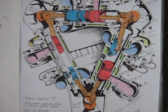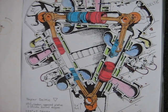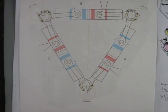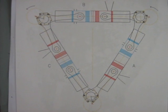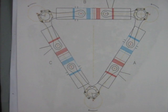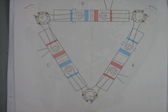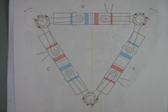The bottom crankshaft turns the opposite direction to the top two crankshafts, and that's necessary to phase the pistons correctly. Here I've made a drawing on the computer showing the three crankshafts and the pistons. This shows that because the exhaust piston leads the intake piston by 20 degrees, the three crankshafts are not in the same phase — so no two cylinders fire at the same time.